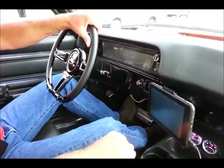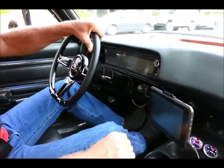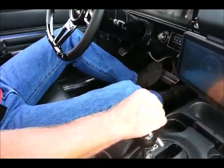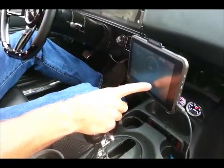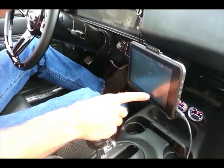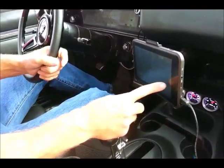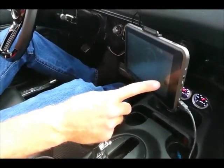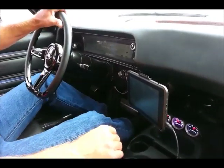It's running really good right now — that base map must have come awfully close. Yeah, most of our base maps are pretty close. As you can see on the eTuner page while driving, the actual AFR is here and our set point is here. As long as the two are lined up, we know we're pretty close. The AFR correction number is telling us how much it's actually corrected — you can see it's making minute changes, maybe 3% here and there.